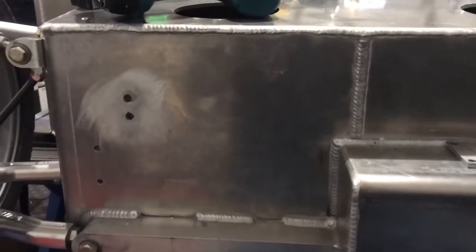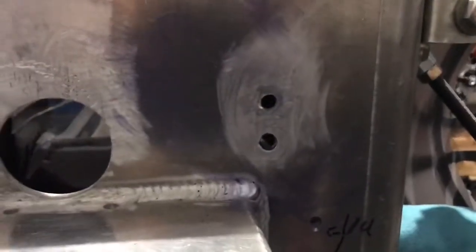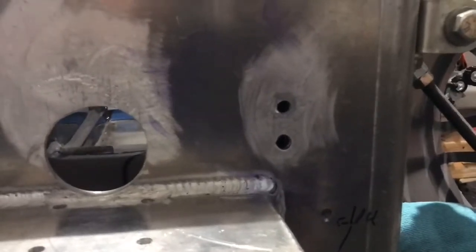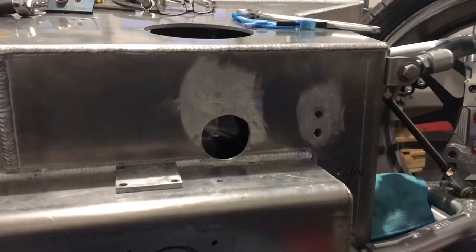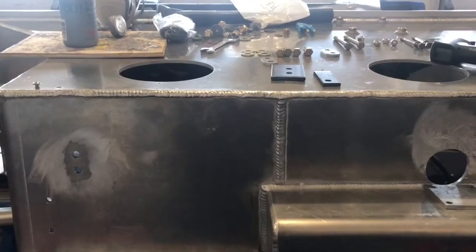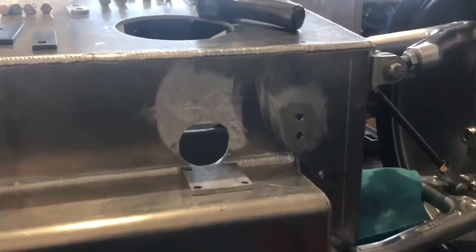Here's the left side - it's welded in nice, and the right side came out just as good. The two torches got the metal nice and hot and it brazed up really well. I also made some backing plates for the steering rack so it's now mounted nice and tight. For completeness, I'll document the final steering rack install. Note on Alumaweld - it's an alloy that's actually harder than the aluminum, so you have to get the metal very hot for it to melt.